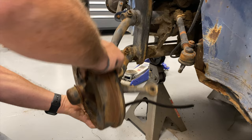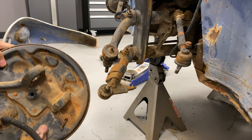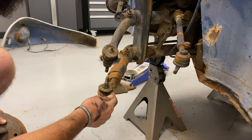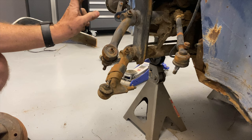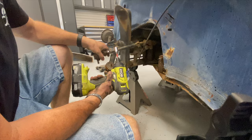Looking at our old brake drum — I'm not even going to bother tearing it apart — but we can see that both of our pins were loose, so all the springs and stuff inside are just free and crazy. Not a problem anymore. These are a problem though: the ball joint is really loose and that boot is torn to bits. Now I've got a debate on whether to just put new arms on — which we do offer — or press these out and press new ones in. We have a press, so decisions, decisions.